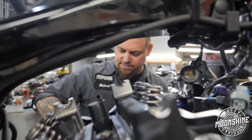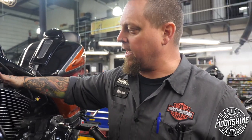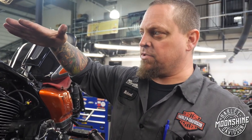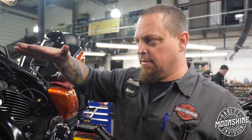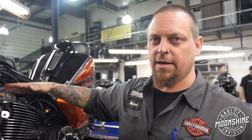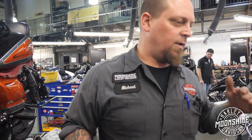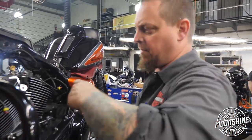As I'm going through this, I think what's causing the pressure differences is as you're going at an angle and you're tightening it down, you're essentially cinching the head like this. So you're causing pressure in different parts of the head and it isn't necessarily being applied evenly. So S&S has changed that by doing their torque sequence in 10 pound increments instead of just a 3-step or 4-step process.